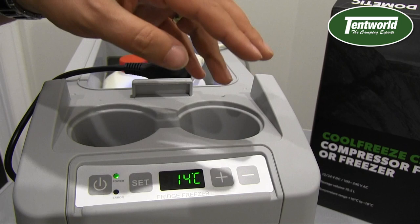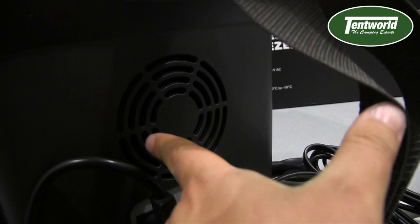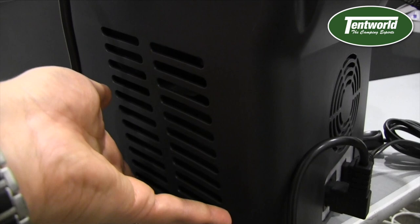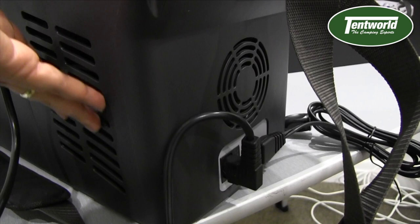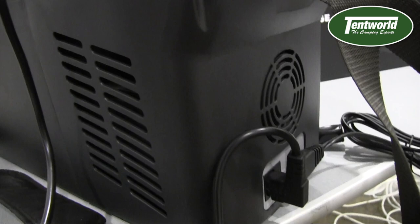Let's have a look around the fridge. Down here where the cables are you can see there's a ventilation fan sucking in air around the sides. That air comes off from inside the fridge, and I can feel air coming out of the other side. It's really important when you install this in your vehicle that you make sure all of these venting areas are not blocked. Blocking them makes the fridge inefficient, or at worst it might overheat and shut down — though it won't be damaged, it has built-in safety for that.